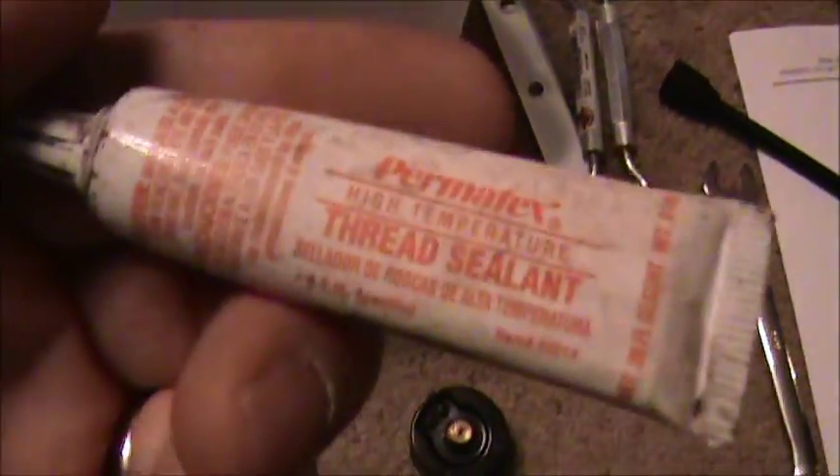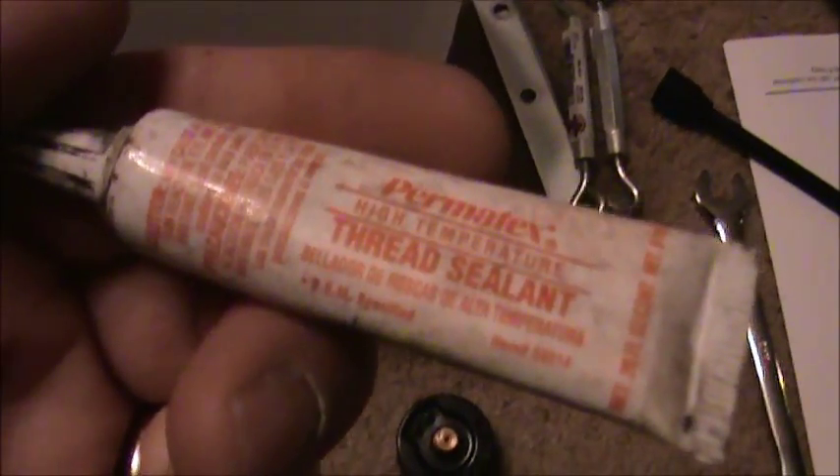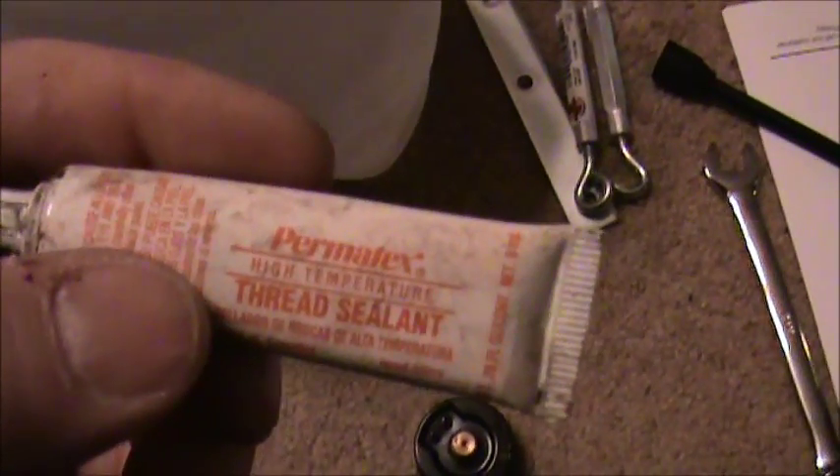You just knew I had the hole drilled for that. If you look real close you can see that little raised round circle — there's actually a pressure bleeder set you can buy that has a gauge there. I went out and got an O-ring and put it on this. I found this out of the toolbox — I'm going to put this on it instead of Loctite. It's a high-temperature thread sealant, basically like a pipe dope. We're going to put that on and screw it back in — that should stop our leak.